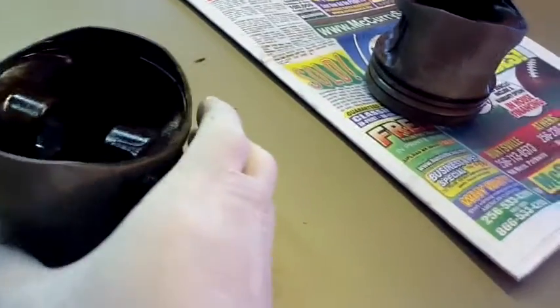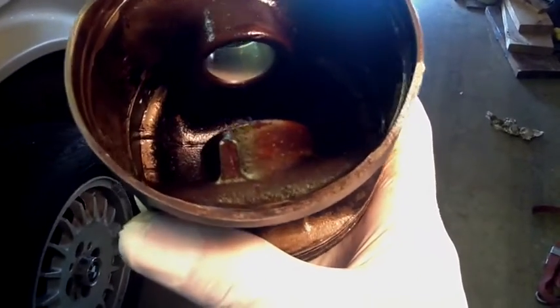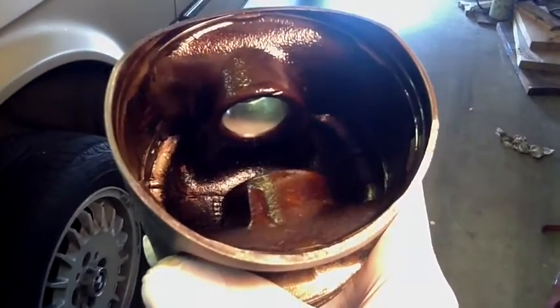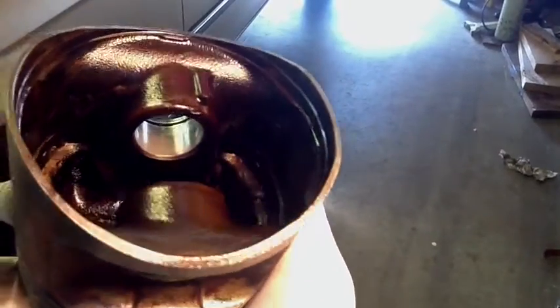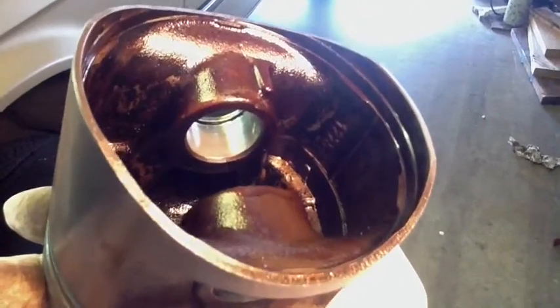On the remainder of the pistons, there was a hairline crack down at the bottom of the wrist pin — actually the top side, but looking down you can see it at about six o'clock. That's cracked. And this one was actually broken on both sides — you can see a small crack going through the bore of the wrist pin.